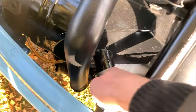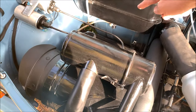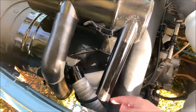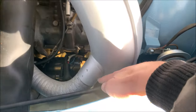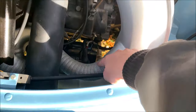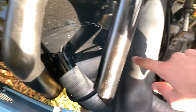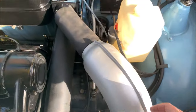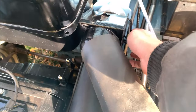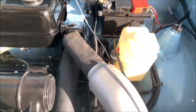Heating comes here. So this is the box with the fan, and here the air goes through the cylinder, so that is the cooling. And also there is a bypass here, so we take air from there, put it in the muffler. It comes out of the muffler, which is here at the very front, so you can see it underneath here. So the hot air comes here, and here additionally hot air, which is coming from the exhaust primaries, you can see this here, is being mixed in here, so you have a better heating. And then that is your box that's mixing everything, and here are your cables to control everything, and then it goes to the interior. So that's very nice.